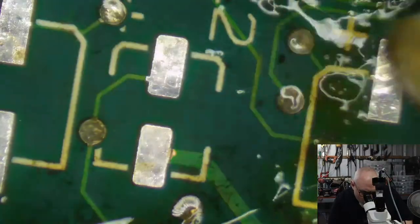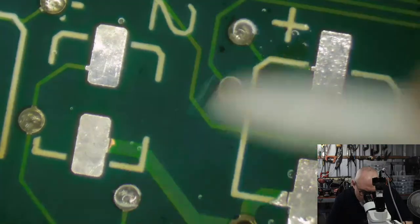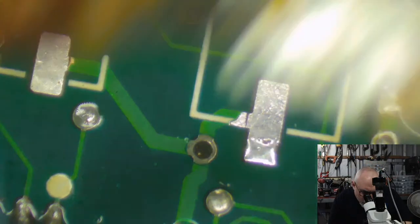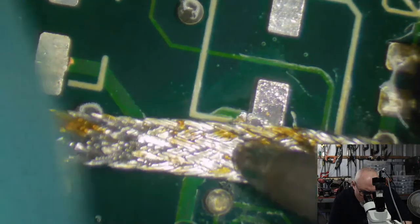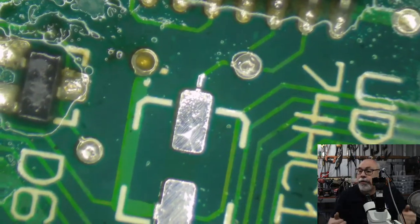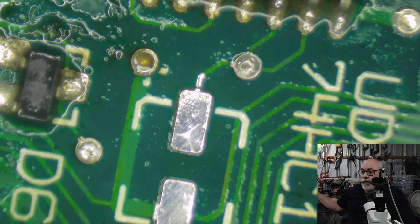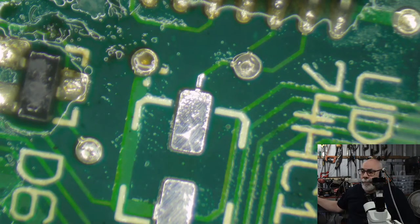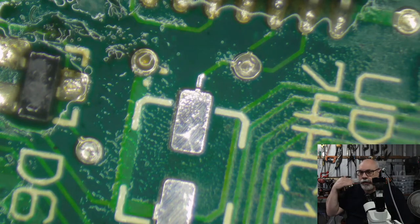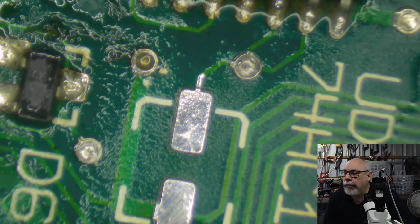Ultrasonic cleaners are really good for certain tasks. They're not good for everything, but they're really good for certain tasks. And when it comes to cleaning electronics like this, they're absolutely fantastic, because they do an amazing job cleaning, but they're incredibly gentle on all of these components and the plastics and all that sort of stuff. The only thing that gets affected for me, and it's probably to do with both the process and the detergent, is aluminium or aluminum. When I put uncoated aluminium in there, it tarnishes the surface. It creates a blackening of the surface. It doesn't seem to do it any harm, but it creates a blackening. So that's just something worth keeping in mind.